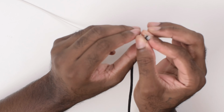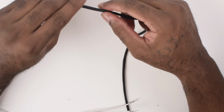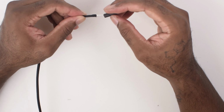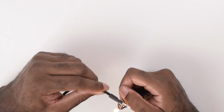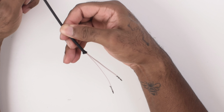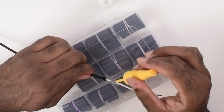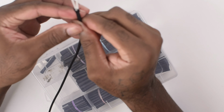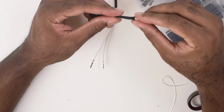Measure out new sleeving on the double wire to the bottom of the wire split. Stretch the sleeving onto the double connection and apply super glue to secure it in place. Cut the sleeving to fit the 2 split wires up the connection.